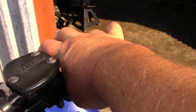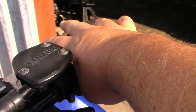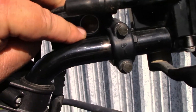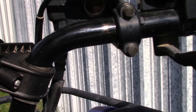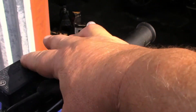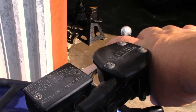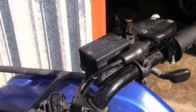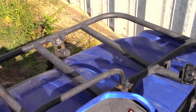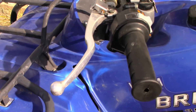The hydraulic brake is a little stiff — this I don't like. You might think it means great brakes, but realistically what that's telling me is that the fluid is old. If you look at that reservoir right there, you'll see that fluid is chocolate brown — it should be virtually clear. The fluid hasn't been changed; it's supposed to be changed every two years. It has degraded, formed crystallization inside, and stopped up the compensator port so fluid isn't really releasing pressure in the caliper. As you ride and that fluid heats up and expands, it has nowhere to go — it'll start applying the brakes, and the further you go the more it locks down. That's going to make handling really sketchy.